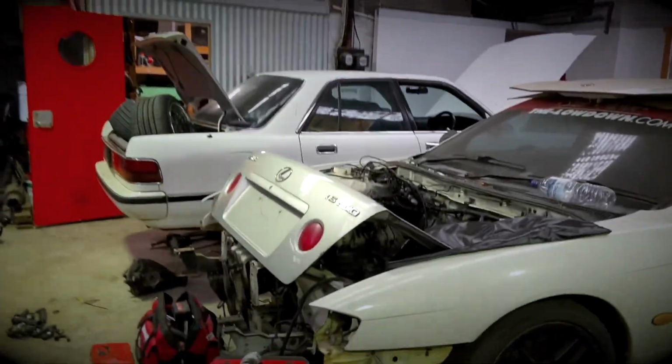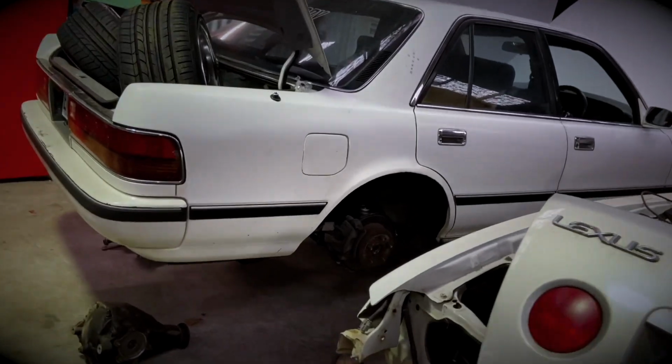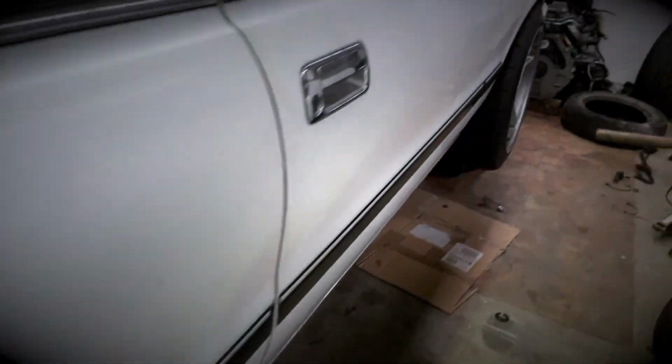Skinner is absolutely crushing this. He's finished putting in all his arms in the rear, as you can see, all adjustable. All new bushes, got some double sway bar thing going. He's redone the knuckles and everything in this, so this car's nearly ready. He needs a wheel alignment, and Dennis at Disco Tunes is rebuilding the diff. He's got a 2-way to put in that, so he's nearly ready. Josiah is not nearly ready, but he should be fine. So it's all coming together.